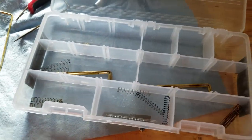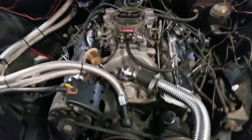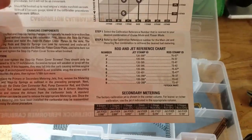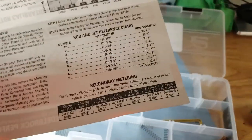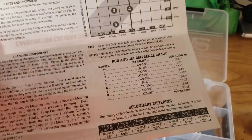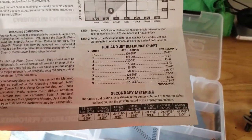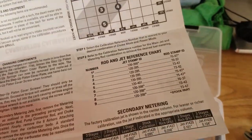The jet is just at the bottom of what we took out — it's down there, although I doubt you can see it. Now if you really wanted to go all out, you'd get an air fuel ratio gauge, put it in your exhaust, and you're basically wanting to get to 14.7 to one. I don't know how realistic it is to get to exactly that, but that's what you would do — though it's very expensive. Otherwise you could just see how the car drives or check out your spark plugs.